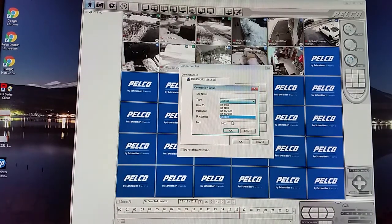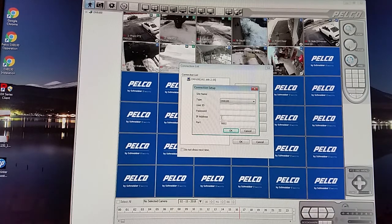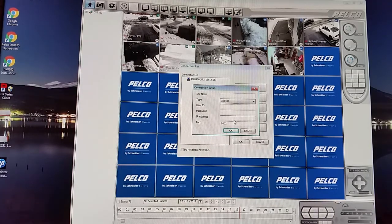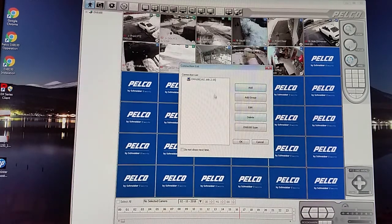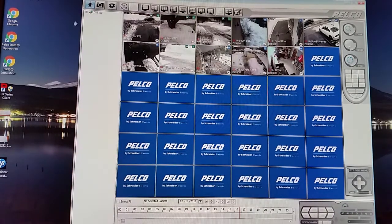I don't see an option for 8000, but you may try it and see if it works. Enter a site name, user ID — you'll need to go into user accounts for that. Give it an IP address on your network; ping it first to make sure it's not already in use. Open a DOS window with Windows+R, CMD, ping the IP address, make sure it's not coming back as used. You can then assign that IP to the DVR — it uses port 9002 for this remote client software. You can add multiple DVRs and connect to them. This all happens behind the router, so you're not going to get into this from outside the network.